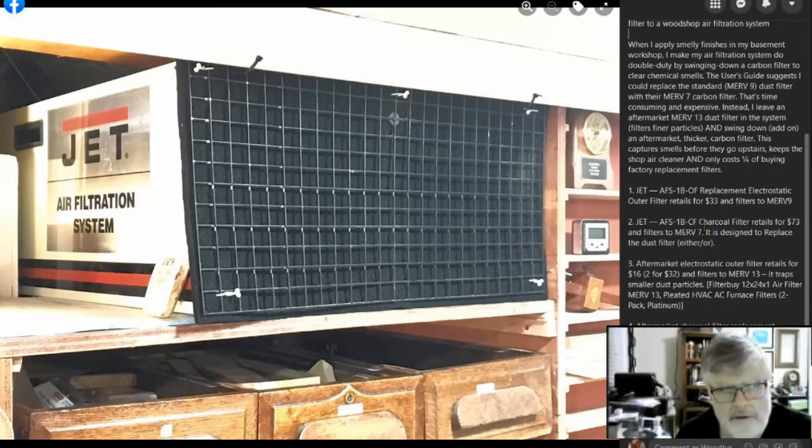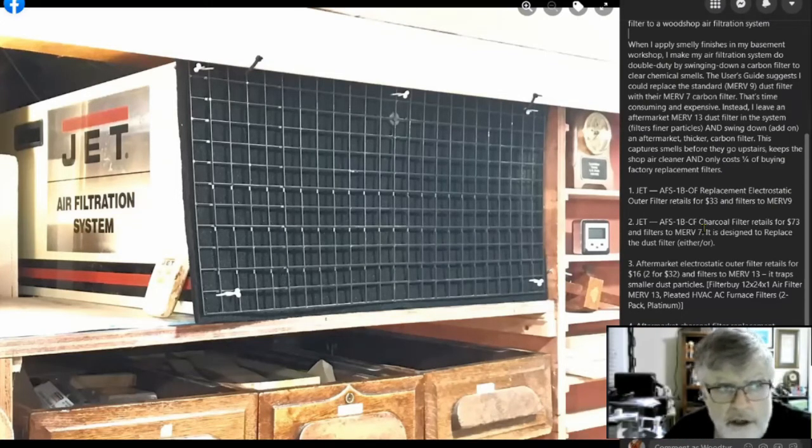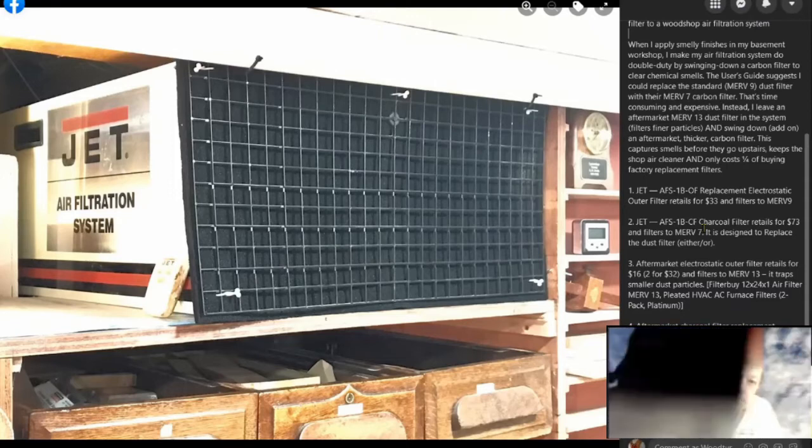Now, there's the air filters that if anybody runs into, I just had mine break and I looked it up and I could pay like $250 for a new board. Wow. Actually, there's a single capacitor on the board that fails, and I think I paid $1.19 on Amazon. Soldered a new capacitor in, and now it works great. So if yours does fail, look it up, not on Amazon, on Google, and you'll find a repair just to replace the one capacitor that typically fails.